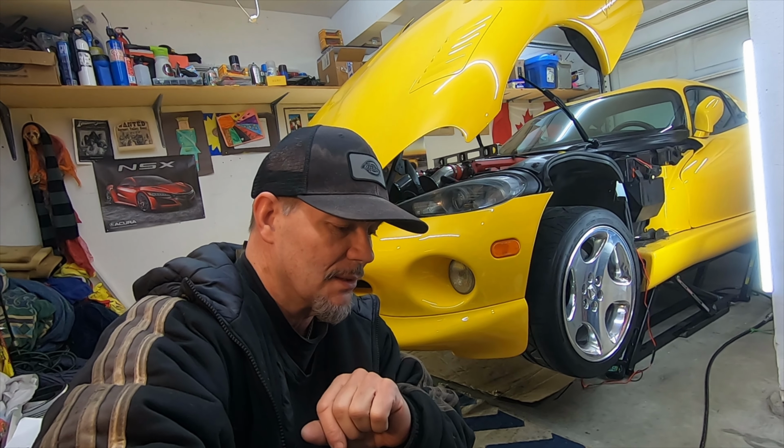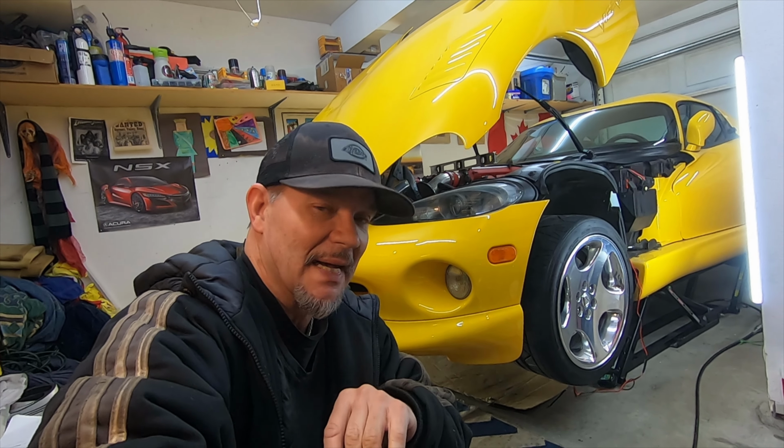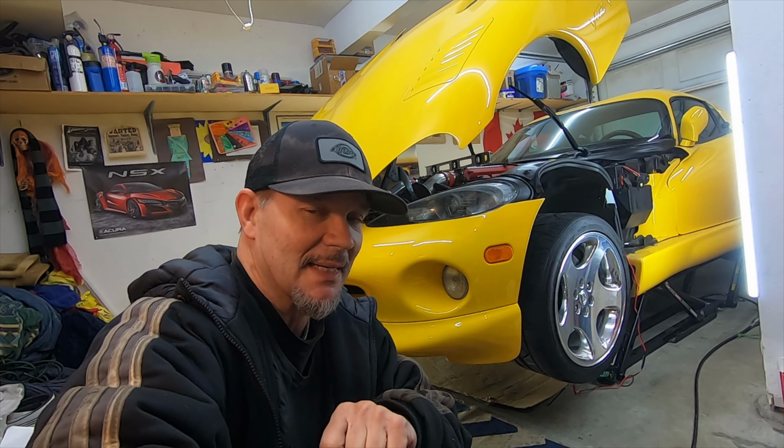where they go through. There's barely enough room so that when you try to lift, the engine only goes up maybe an inch, and that's not quite enough to get the motor mounts in. So the only real answer would have been to take off the headers, and I did loosen them at the cylinder head, so I had a few extra millimeters there, but to take them off, it's a big job. So I'm glad I didn't have to do that.